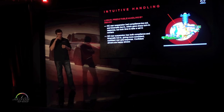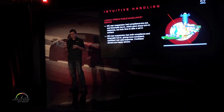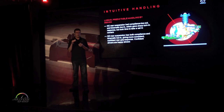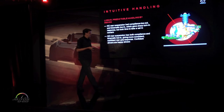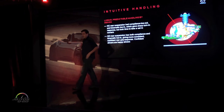So we've made this one so that both the compliance steer and the kinematic steer are both toeing in — everything is moving in the same direction. It makes for a much more linear turn-in response and a much more predictable feeling. The more predictable and communicative the car is, the more comfortably you can drive to those limits. What's going on in this diagram: the dotted line is the virtual steering axis of the rear suspension. Because two specific bushings are very stiff, the suspension pivots around those under compliance. Because that axis hits behind the tire, when you put a side load into the tire it pulls it in a little bit and toes it in — that's how the compliance steer happens.